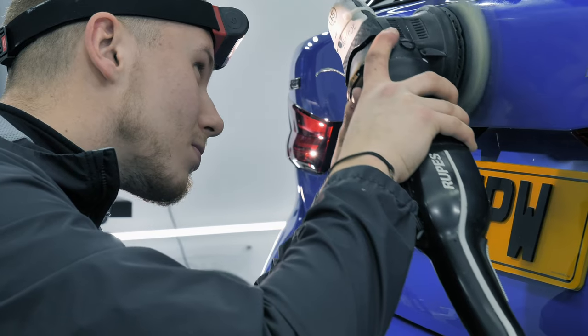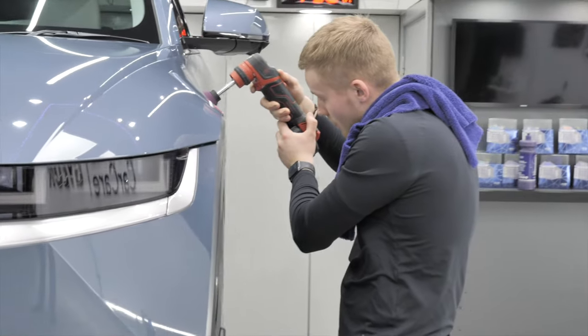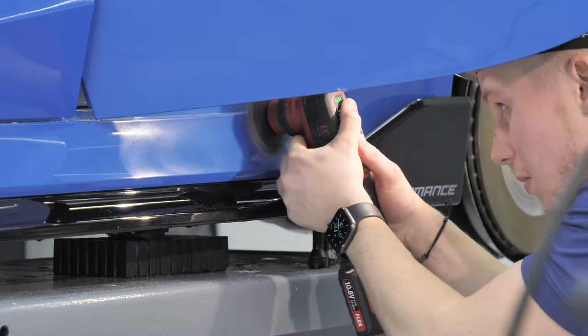In terms of difficulties when machine polishing or doing paint correction, most difficulties come from using a rotary machine polisher — that's when things get very difficult with body angle, position, and angle of attack when addressing a specific paint issue. Access is another factor: what machine will you use to reach the angle where the defect is? Using extension bars, high or low speeds, pad combinations — there are lots of variations involved in solving that problem.